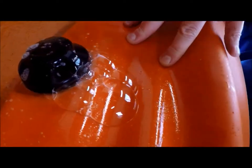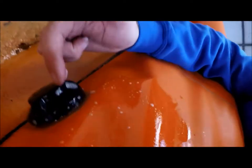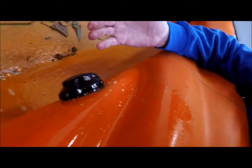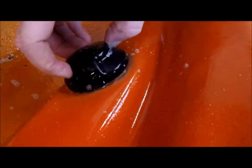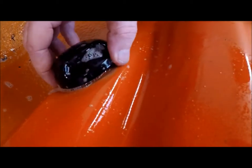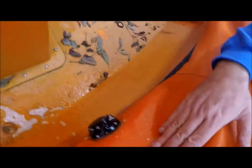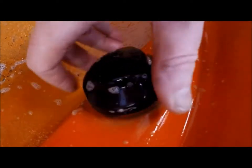Now what happened was this valve — the cover has got a dust cap on it and it's got stuck. It's not — I don't think it's cross-threaded, it might be cross-threaded, but it's definitely stuck, it won't come off. So when you turn it, what you're doing is actually unscrewing the valve head.